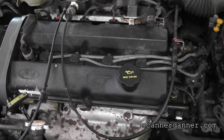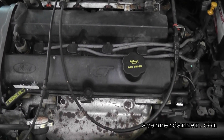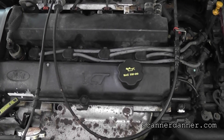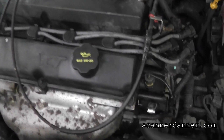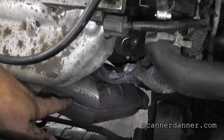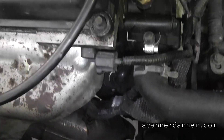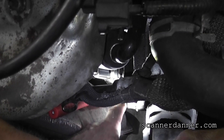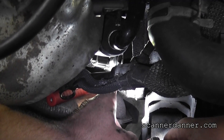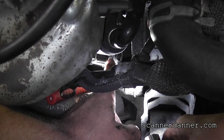So we did some digging. We looked in the typical locations around the harmonic balancer in the front — couldn't find the crank sensor. We ended up having to pull a diagram to find it, and it is buried below, like behind the catalytic converter, and it runs down this harness. The sensor is down in this location right where my index finger is pointing, and it looks like it reads off of the flywheel on this design.